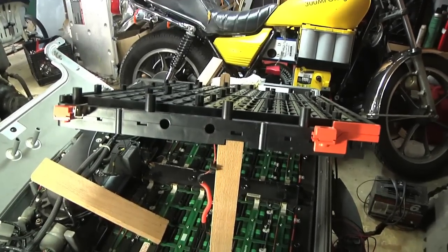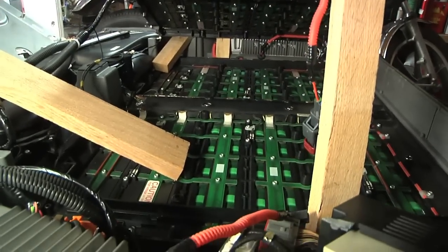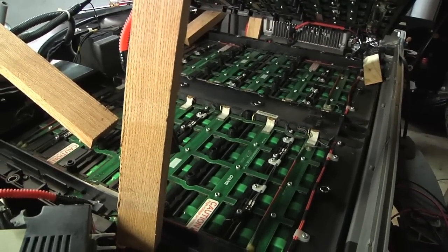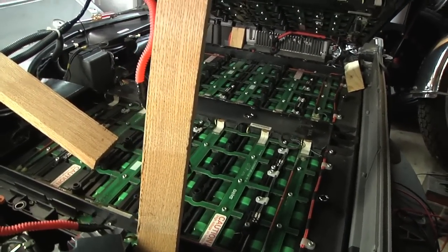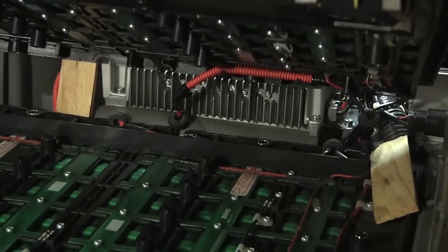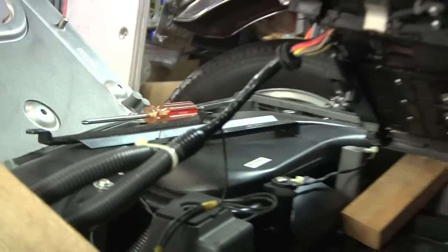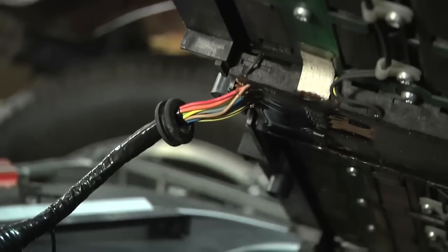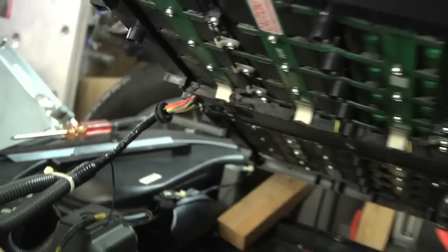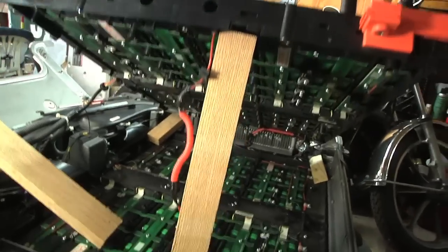Okay, here we go — I got the top disconnected and pried up. Now that it's apart, we can see the top half and the bottom half. There are lots of little wires running around for battery management primarily. In the back of the pack there — that would have been the driver's side — there are some connections I've got to disconnect over there, and there's one here. I'll have to find the quick disconnects and disconnect those, and then I should be able to take off the top half of the pack and break out cells.